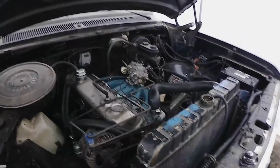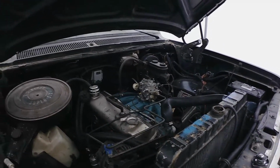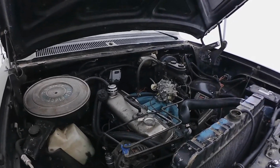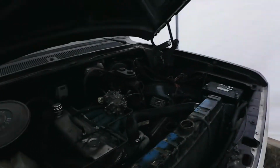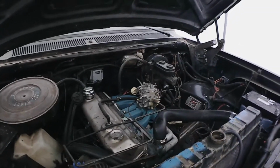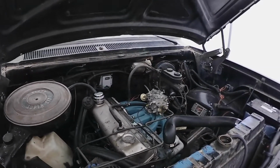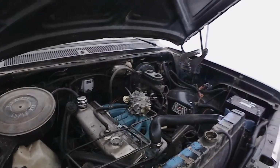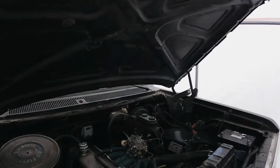When I was driving it, it wasn't a big deal. And last February, when we had that cold weather come in, I parked it in the garage, so I didn't worry about it. All right, well, I got the battery, I need to hook it up. I'm going to pour some gas down the carburetor. I've done a general look over to make sure nothing weird's happened, that rats ate anything, so it should be good. So I'll see if I can do some initial crank up right here.